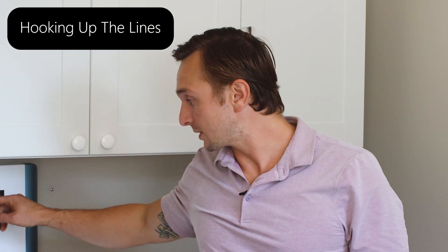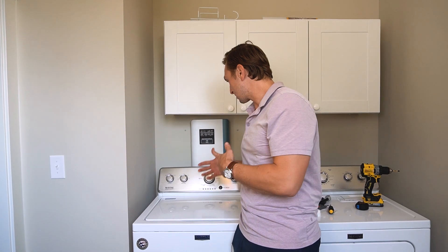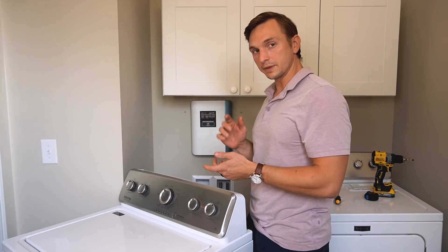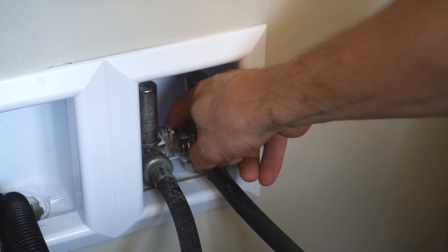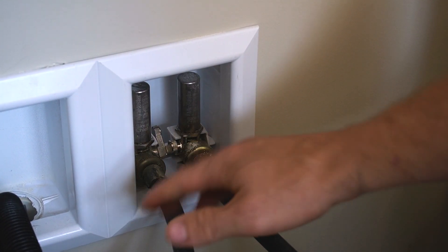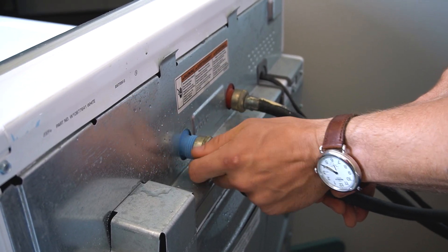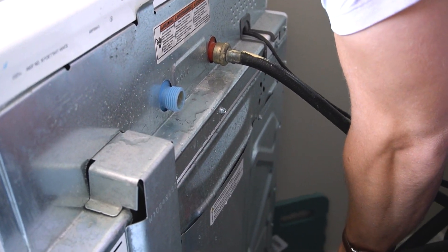Now that we have the machine up, the next step is to connect up the tubing. You're going to need to pull the washing machine out from the wall. Before you make any disconnections, make sure you turn your water line off at the plumbing — just flip down the handle. Since I'm just doing the cold water line I don't need to turn off both, but you'll still need a bucket because some water is going to drain out of the tubing when you unscrew it.